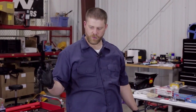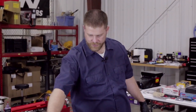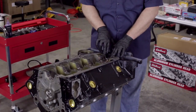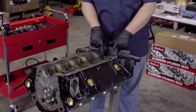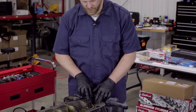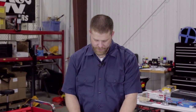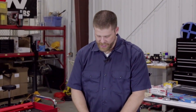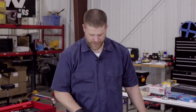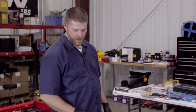We've got everything apart, cleaned the plastic gauge off the crankshaft and off the bearings, and lubed up the upper bearings. We went ahead and laid our rear main seal in. Some people will lay this in flat to the surface, but that creates weak points where you can get oil leaks. What we're actually doing is staggering the seal a little bit so that when we lay the top cap on, we stagger it the other way — that way we don't have a seal-on-seal crease right where the two pieces of metal meet.